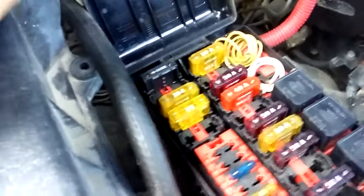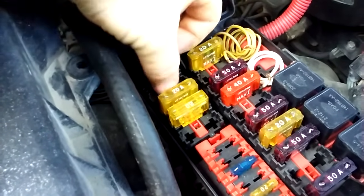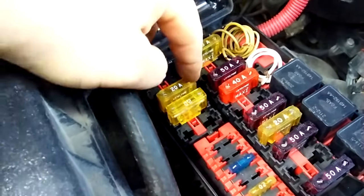Couldn't get that to work, so I came up and checked this fuse — it's the third slot back on the left side, that's for your fuel pump, it's a 20-amp fuse. It was good, so that meant the issue was from here to the switch in the cab, and then from the switch — if there was power there — on back to the fuel pump.